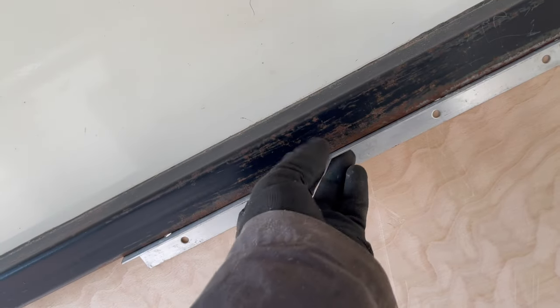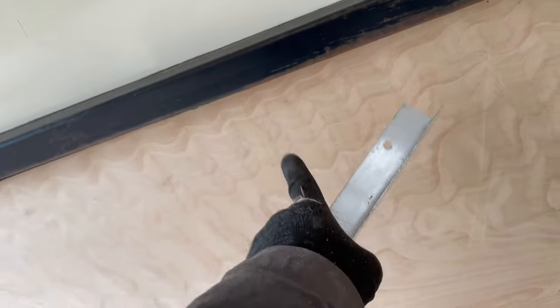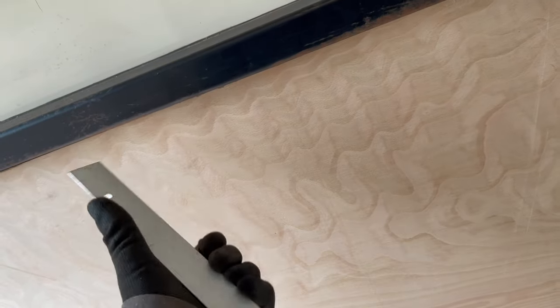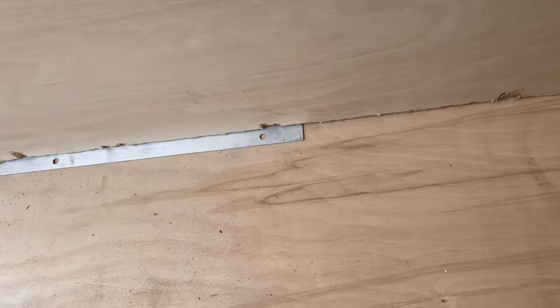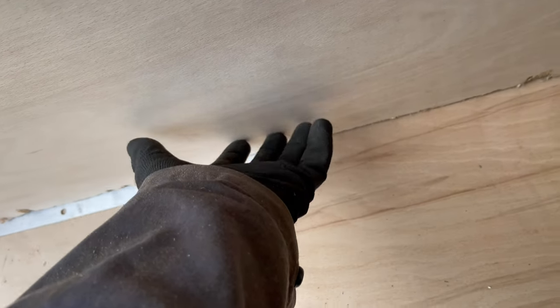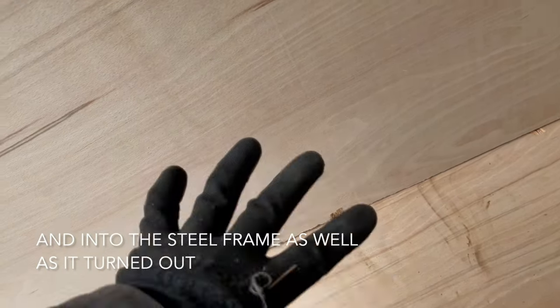This part, as it'll be hidden behind the board, will be supporting the board. So when this board tries to move in that direction, the rivets are at right angles so it'll be quite strong, and a lot of them will be firmly supporting it against the steel square section bar going across. Similarly around the bottom - you can see the angle section braced out supporting this board. This will be screwed down into the lower board so the lower board will then be holding the sideboard, preventing it from moving forward, giving it a great deal of strength - double the strength you had originally.